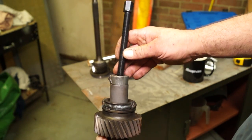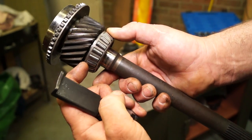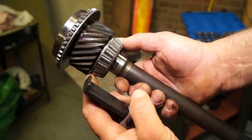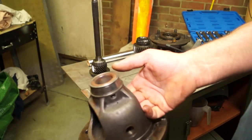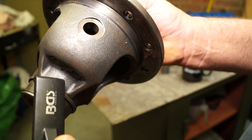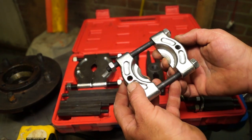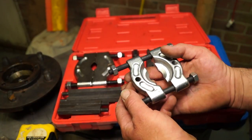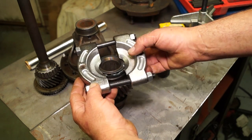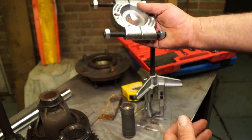Sockets and bits and pieces in your toolbox will be of use. The other thing is the feet will not latch behind the bearing cage — you could possibly pull on three sides and actually pull the bearing off. The best thing to do is to actually cut the cage and get rid of the rollers, so you'd end up with just the other part of the race. This diff carrier has a peg as I said, but unless you have the right pull kit it's going to be a problem. We also have bearing clams or clamps — I call them clams — and basically you put them underneath the bearing and then pull, but you've got to have loads of different sizes and this isn't the right size for what we need, so that goes back in the kit.